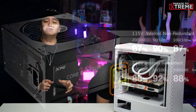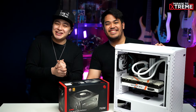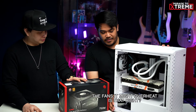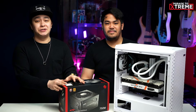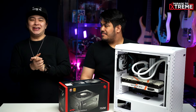All right, so the last to install is our PSU, and this isn't something to skimp on, so make sure to get a reliable and efficient PSU from reputable brands. In our case, we chose the XPG Core Reactor 750W PSU. I think there isn't a wrong way of doing this one, right? Unfortunately, that isn't the case. Notice that your PSU has a fan? We have to make sure that nothing is blocking the fan. Yeah, that makes a lot of sense, because if we block the fans, it might overheat. The XPG Core Reactor PSU is a modular PSU, meaning we have the option to just attach the wires that we'll be using, unlike non-modular PSUs where everything is attached and can't be removed. Trust me, this will be a great convenience for our last step.